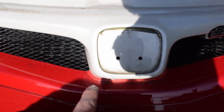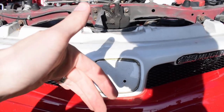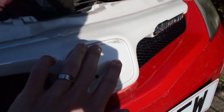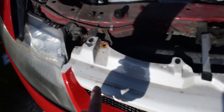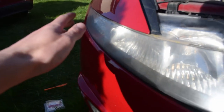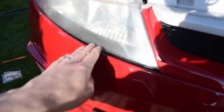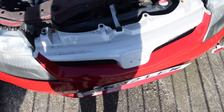I've cleaned this in the same way and we'll get the new one back on. I can see through there so I might be able to use those washers after all. Your best bet for accuracy is to take the whole bumper off, but I'm going to try and fathom it by reaching down. There's just a tiny bit of residue from the previous one. This newer grill is mounted to the bumper not to the old mounting points. I can pull the bumper away from underneath the lights — they're just fitting clips — and pull the grill away a little bit too. That gives me an extra centimetre or two so I can reach down and feel where the holes are. I'll go down with a little washer, get the adhesive bit on, then pop on the washers.